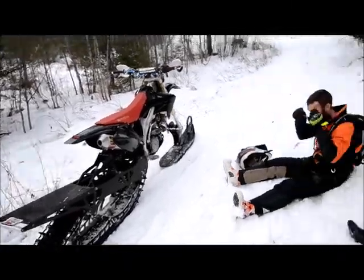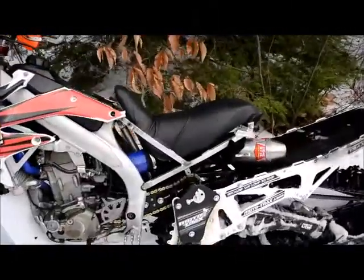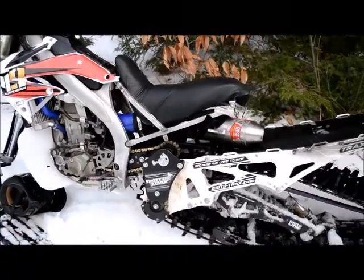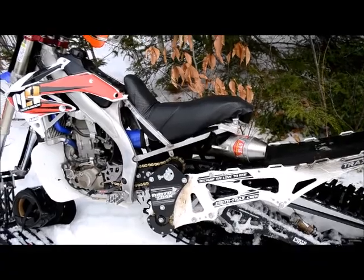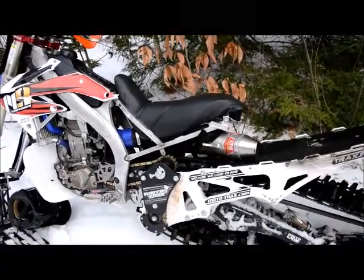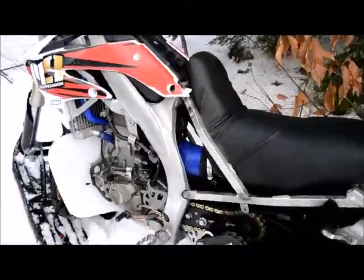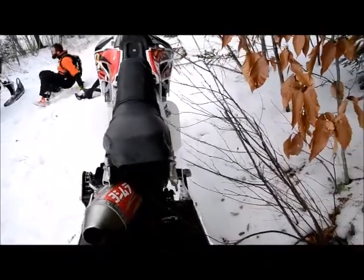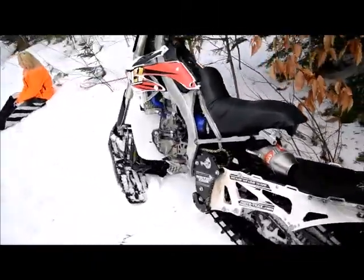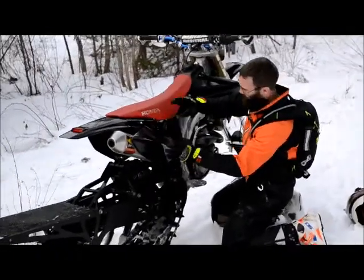That's aluminum too, but just aluminum bars, more or less like square stock. But I want to make it adjustable, so you probably still have to use a 10 millimeter, because the top ones would click, loosen them up. Just have a spot where you bolt it on for the regular ride position, because it's the same seat, the same lower bars, and it ends up being the same height. All I end up doing is cutting where this bar hooks right here. I just cut that, lowered it way down, and welded it on where it was as low as it could go.